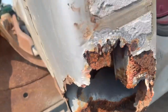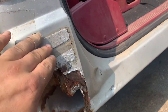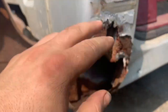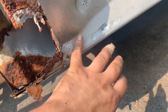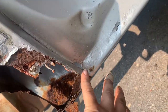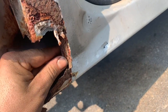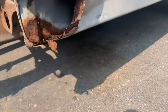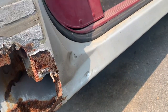But I'm gonna take a scuff wheel or something and grind that off. Take a die grinder or something and grind around up here further. See how far good metal is, how far I got to take the cab corner up, and clean up this rocker area here, and then here in the jam. See how much of that's still good metal. Hopefully I ain't got to make too much for that. So yeah, that's what we're gonna do.